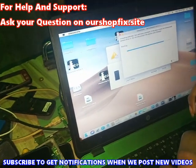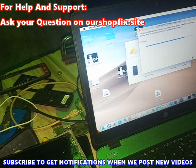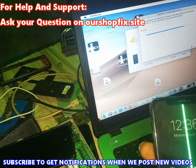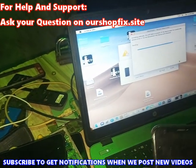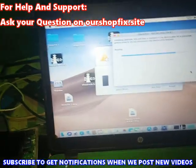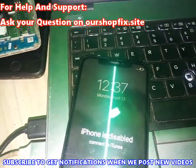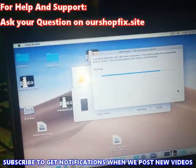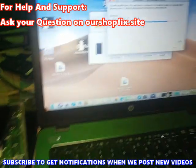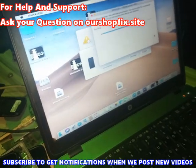I think I got an error — this is what I've been explaining. I didn't hold those buttons well the first time. If the phone boots to the home screen like this, the USB is going to detach itself from the computer and you'll end up getting error 20. I'm going to restart the process so you can see it. I've been working on this for three days and finally got the guide.